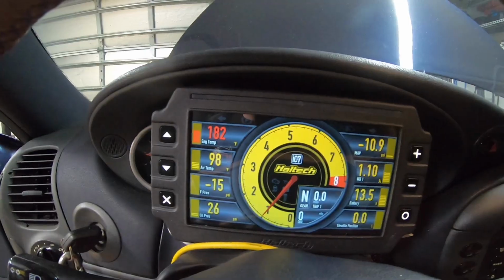So guys, I think I got it figured out. It works. We have a car that doesn't overheat, and now it shouldn't overcool either. So I'm just gonna drop this right down to 180 and see what happens. Make sure it doesn't dip below 180. Well, I've been sitting here with the fans ripping, which would also represent 40, 50 mile an hour airflow on the road, and I cannot get it below 182. So that's perfect, guys. Like I said before, without the thermostat, I got it down to 175 until I stopped. So I would assume I can get it colder. I live in Florida, so it's not that big of a deal, but in the winter, it gets to the 40s, 50s, and we don't want it to get overcooled for sure.